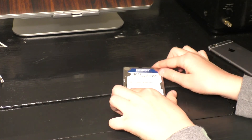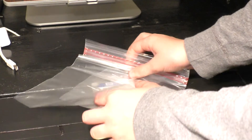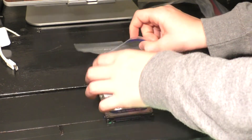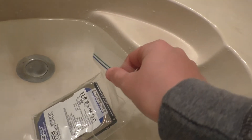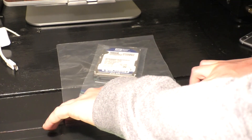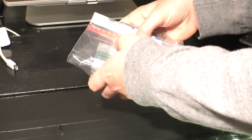Now let's move on to the bare drive. Grab a few freezer bags — preferably one small and one a little bit larger. First, put the bare drive into the smaller bag and then vacuum seal it using either your mouth or by securely closing it up and then dipping it under water to seal out all the air from inside. Make sure there's no air inside. Do the same for the larger one — just put the smaller one with the drive into the bigger one and also make sure there's no air in that one.